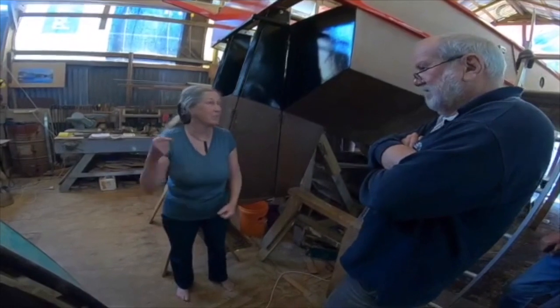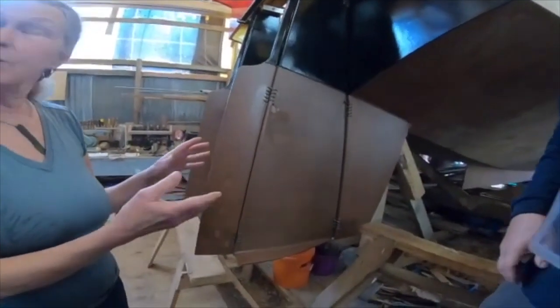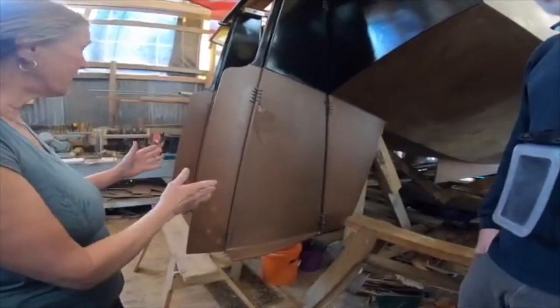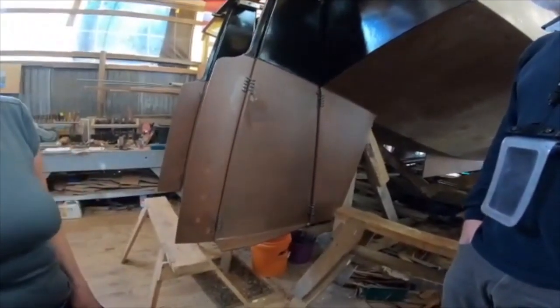There's no rigging, so you're not trying to push your mast off in the boat all the time. Because I've got shallow draft, I had two choices: either a rudder that lifts up and down, which I didn't want because of the complexity, or to get the same area and have two rudders. So I went for the two rudders.